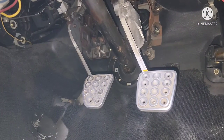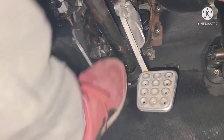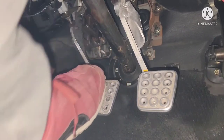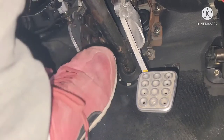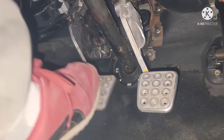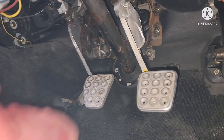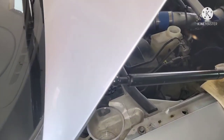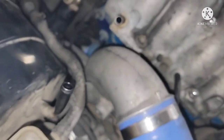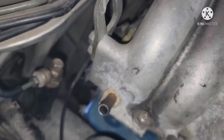Let me quickly show you how the clutch pedal feels. It's a little soft right here and then it gets firm halfway in — this is really good. Just keep pumping it and bleed it out again, keep doing that and you should be okay. Up front, the reservoir is still good. There's our master cylinder for the clutch — no leaks.